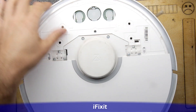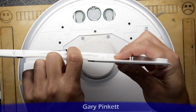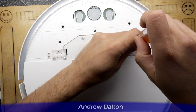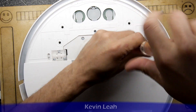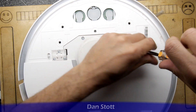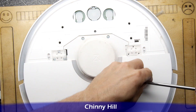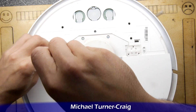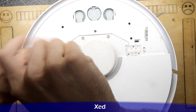What you want to do is just pull off that top panel. It has these push grommet things that pop it — just un-pop those. If you're used to working on cars, you'll definitely be used to pulling those apart. We do have to take off this hinge, unfortunately, because it does obscure access. It's only three screws in each — try not to lose those. Once you remove those three screws, you can remove the back flap.